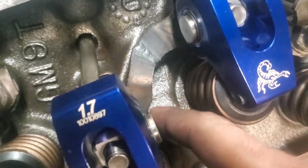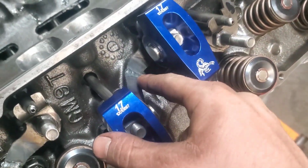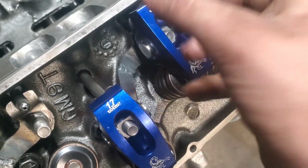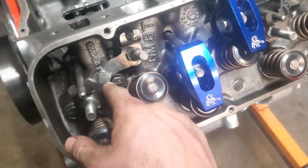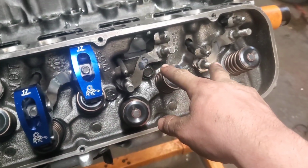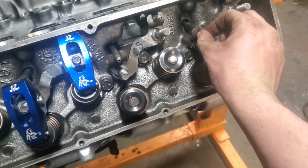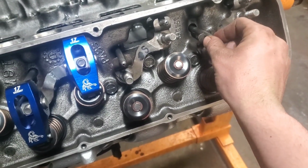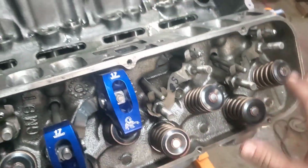So I've just been going through with each of these guides, and you may notice that they're welded. So like that one right there, I cut it, and then I set this one, and I set this one, and I left them in place, and I tacked them right here and here while they're in place, and I took everything off, and then I went and welded that up there, and I welded on the back side. Same thing with that one. And these two came out good. You can even grind down in here to get them to fit. What happens is this push rod won't allow you to go to one side or the other, and it makes it clocked. So all of these on this head are completely good.